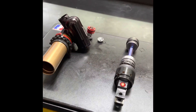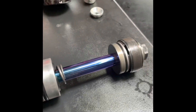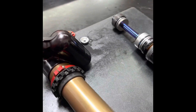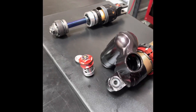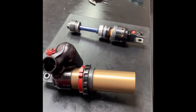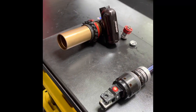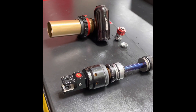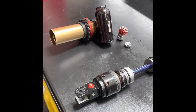One last look at this A-Kit Showa shock before we put it back together — someone's definitely got some use on it, but all the critical wear parts have been replaced. A-Kit componentry shares a lot of parts with production stuff, which is awesome. That means stuff that is developed and made for A-Kit has seen its way into our production bikes. I've got a lot of work to do here at the shop — things have not slowed down since COVID — so I'm not going to be able to walk you through how we assemble this. But just like any other shock, there's two ways you can do it: you can put it on a bleeder machine, or you can put the shock in a vice and hand bleed it as well.